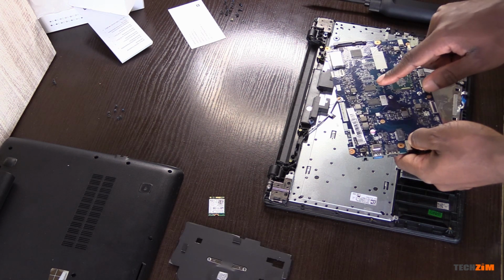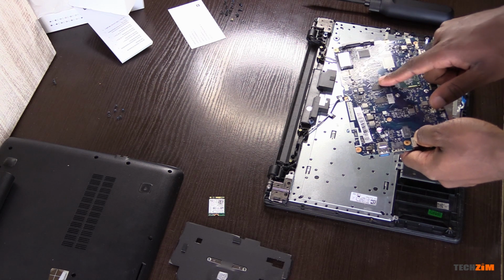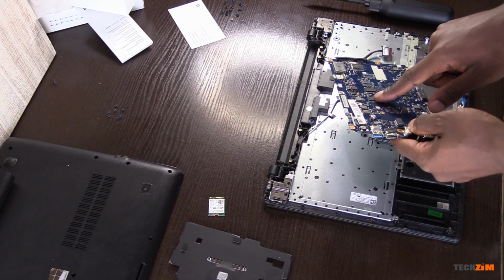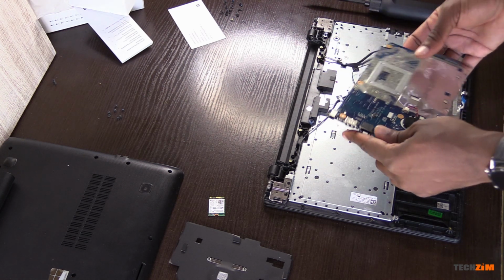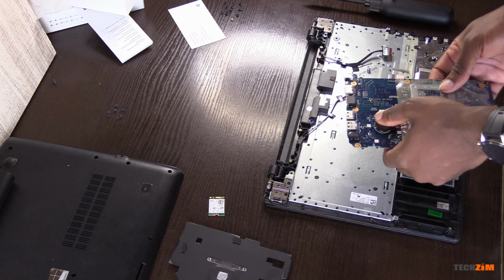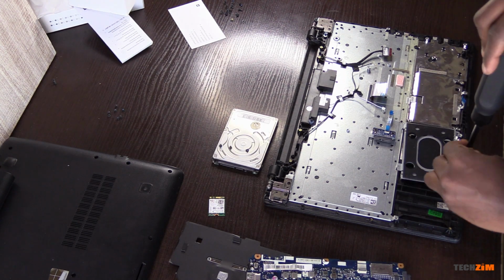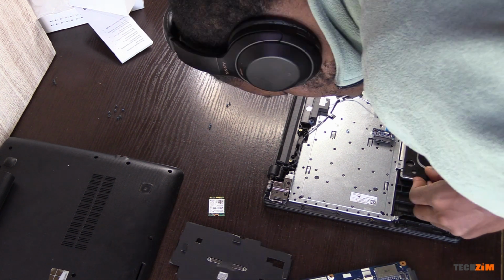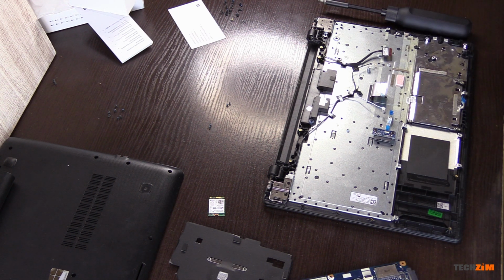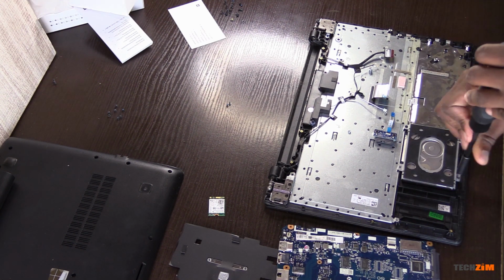These two chips are the 4 GB of RAM that come with this PC. There is no way to expand it, so what you see is what you get. There are two empty bays where more RAM chips could have been added. Underneath is a CMOS battery that maintains the state of the BIOS on the motherboard. The hard drive is supposed to be in this cage, but it is missing, and I would much rather love to add it back to this PC. It is dead though, so I'll need to replace it so I have a PC for emergencies or experiments like these.